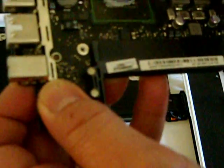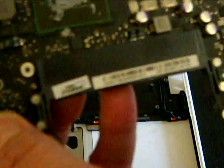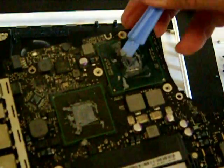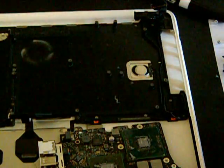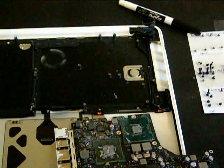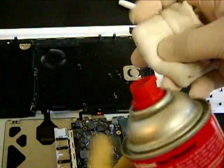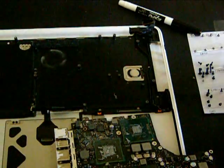All you have to do is remove the old thermal paste and replace it with a good one. I usually use the silver compound — silver paste — and I clean it with brake cleaner, only on the portion of the CPU as well as the heat sink. Please don't use the auto brake cleaner with your plastic parts.